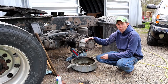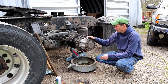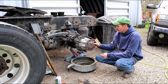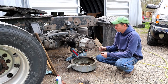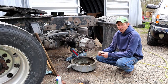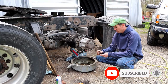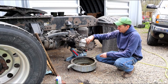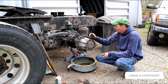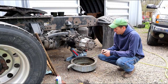Short video on disassembling the hub, taking the seal out, putting the new seal in, then putting it back together. First thing: get the nuts off — I've already taken them off with the impact, it's kind of loud. They are lock nuts so you'll probably need an impact to take them loose. There are little washers on here — make sure you take those off before the next step or you'll probably lose half of them. Use a screwdriver to pry them off if they're stuck.